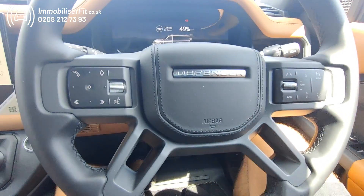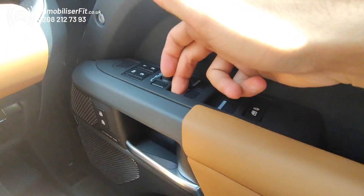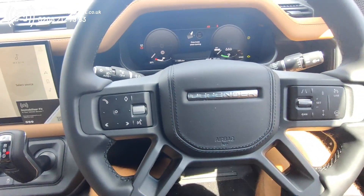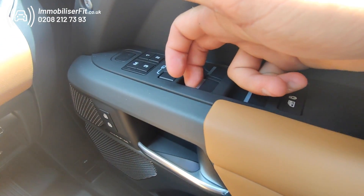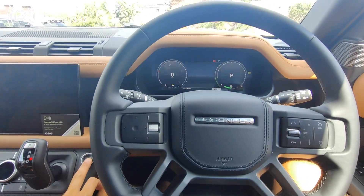The way you change it is: without your foot on the brake, turn the ignition on and pop your disarm code in to authorize. We get our confirmation. Now press any button five times — one, two, three, four, five — then cycle the ignition off and back on. We'll get five bleeps.